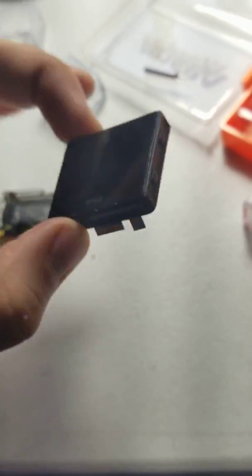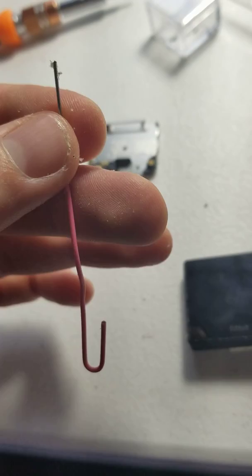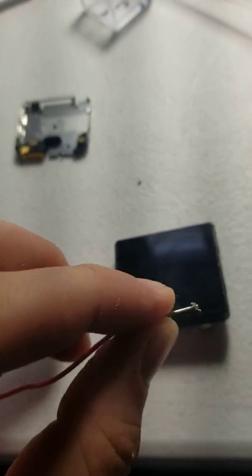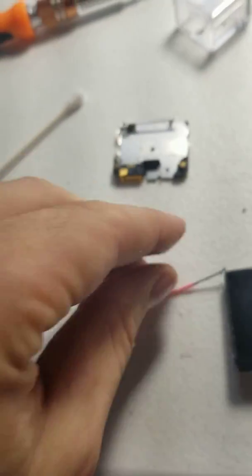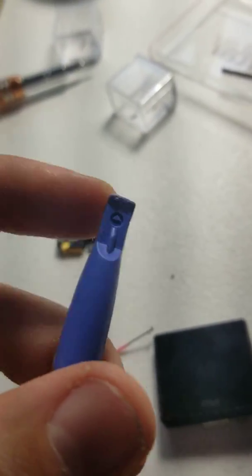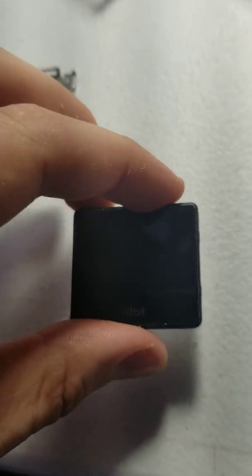Once you get the majority of it cleaned up and it's sitting in there pretty solidly, you can let it dry. It's a good time to clean your hands. I ended up using the tip of a paper clip very carefully to get in the groove, but you've got to be really careful with anything metal because you can scratch the screen or crack the glass. The best thing to use if you can is a plastic spudger, especially if it's got a real sharp tip — sometimes you can sharpen these up a little bit with some sandpaper. The goal is to get it to sit in there pretty solidly and not have too much adhesive leak around the edge, and make sure your orientation is right with your two buttons on the right side.